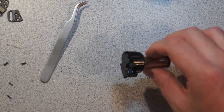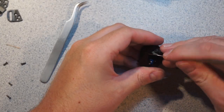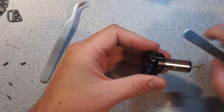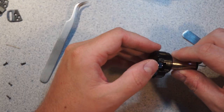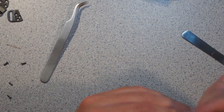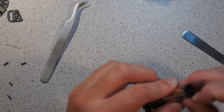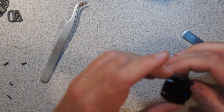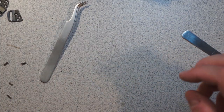And then here's this really quite involved gearbox thing. It's got a lot of gearing in it. And then it's got like a clutch of some sort, and then this is what engages. So I bet depending on the direction you drive this, it probably engages. It either forwards or reverses the film, so they have one motor doing many different things by driving it different directions with clutches.